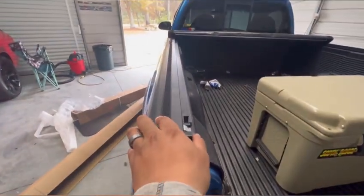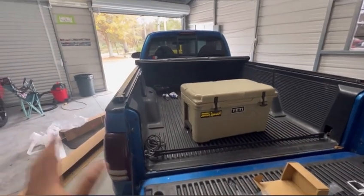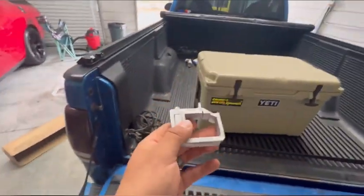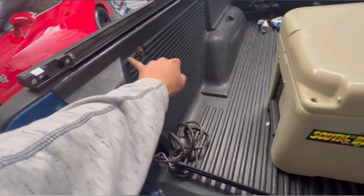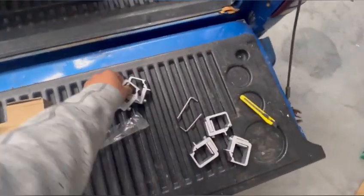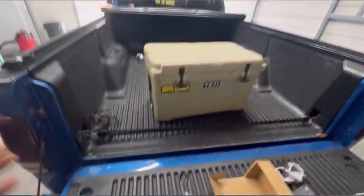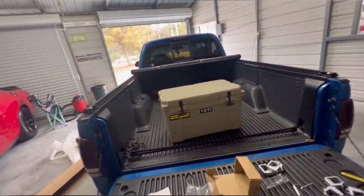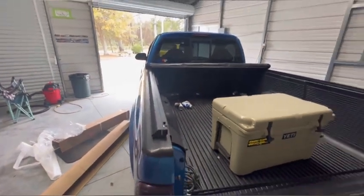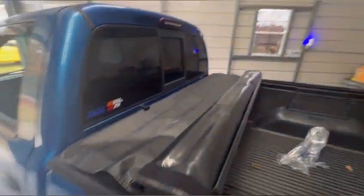Align them and roll it forward to see if it's squared. If it's squared, roll it back forward. I don't want to trim my bed liner, so I'm probably just going to drill holes in the bed liner itself with a hole saw. Looks like it clamps in there - we have six clamps, three on each side, with allen heads. Everything is provided. Let me throw it on the bed and find my squared-away point. From what I see it looks squared already, but I'll sort that out off camera since I don't have a tripod or GoPro.